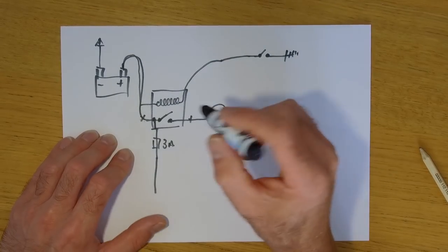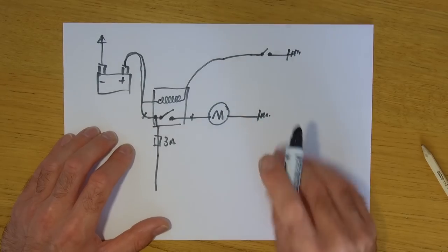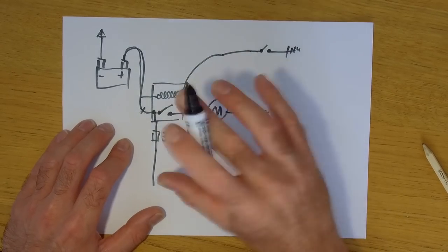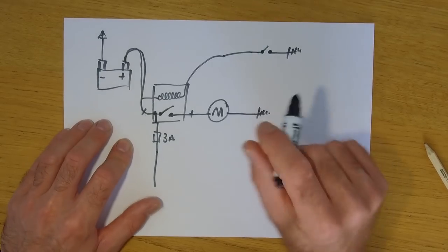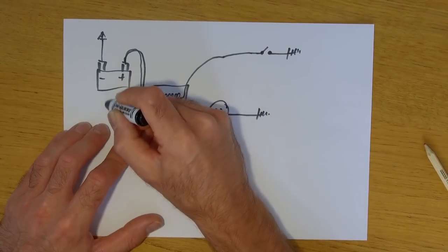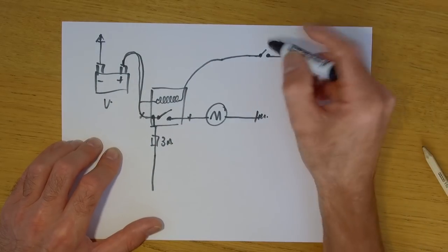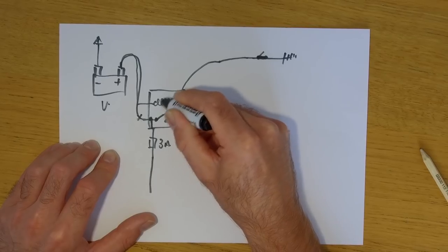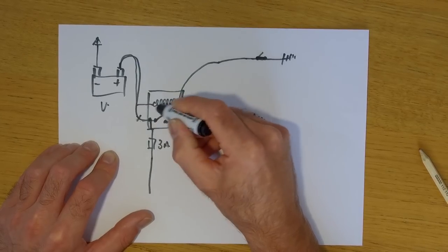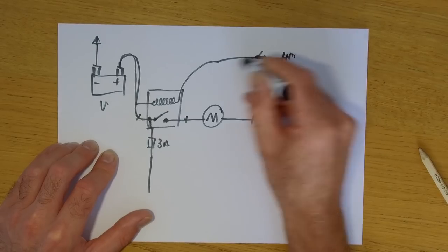Anyway, to the point, why have you got that funny buzzing noise when you push the button on your handlebar? Because that's what tends to confuse people. They think something weird is happening. It's not. All that's happening is the battery voltage in this battery is very low, and when you switch this switch, you energize this winding here. It's normally a ground side switch, so you're switching it with an earth.